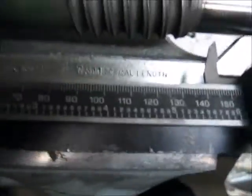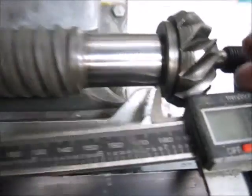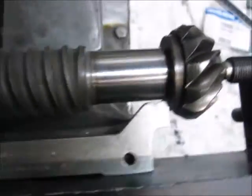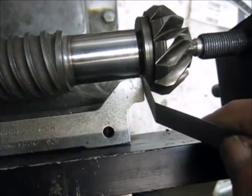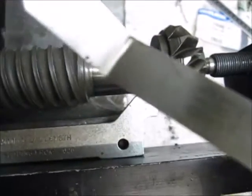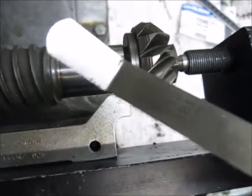You would use it in this type of mesh — measure from there down to here. But in our case we're using this with the set spacer. I've already pre-measured this. This is the feeler gauge, used pretty much the same way you would gauge the points. It ends up coming out to about 15 thou on this one. But whatever it was — if it was 10 thou or 16 — you would subtract that from the 20 thou.